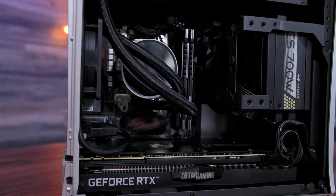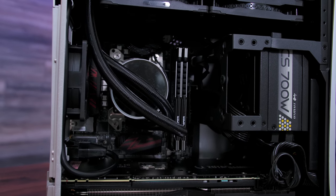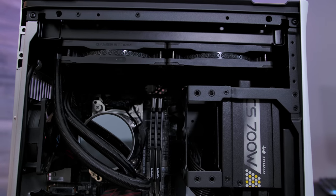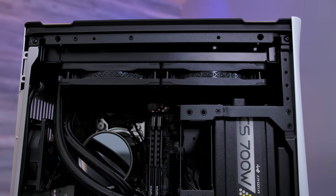So how do we round up this build? Obviously I wasn't able to get all the components inside this case that I wanted to, but in the end I am pretty happy with the results. Clearances are definitely a little bit tight inside this case, but in Fractal Design's defense I did put pretty much the max size components I possibly could inside of the Era. I'd like to see the Era just a little bit taller so I can see additional 120mm fan intakes on the bottom and still be able to use a full-length graphics card. If you read the manual and make selections based on any potential clearance issues, you shouldn't have a problem building a pretty fantastic system inside of the Era. Keep in mind that your CPU cooler, storage options, power supply, graphics card, and fan support will be limited based on what components you select. Your power supply selection could limit your storage configuration options, which might make you change your CPU cooler configuration, which might make you drop your power supply mount down a little bit, which could impact your graphics card length options — and any combination of parts therein between.